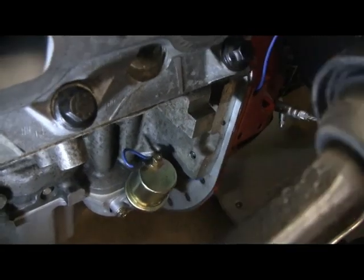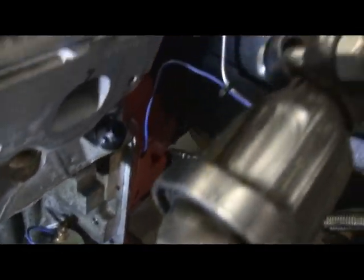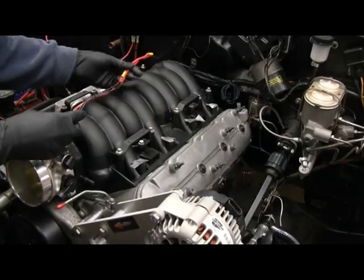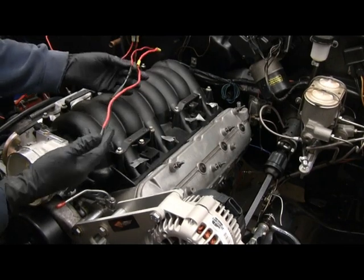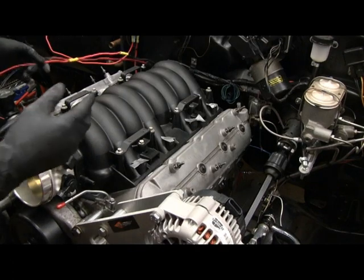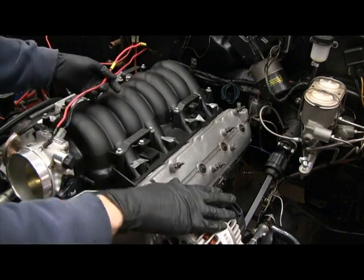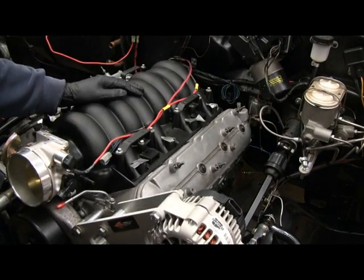It came out relatively neat. You can see the blue wire — I basically run it through one of the open holes in the bell housing and up, then over and into the firewall. These are for the alternator, which is a set of wires that have been modified probably half a dozen times — some by me, some by the previous owner. The alternator for the small block Chevy was on the passenger side, but this one's on the driver's side, so we need to get the wires over here. Plus it's a totally different kind of alternator than what was on here before.